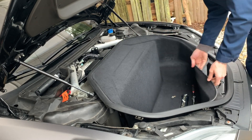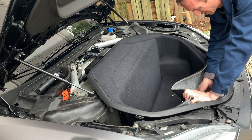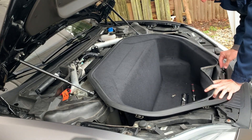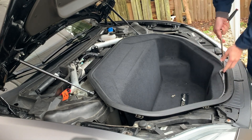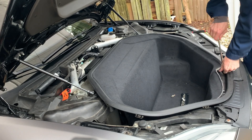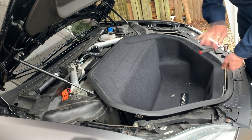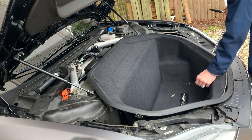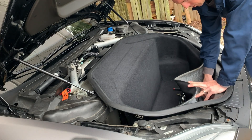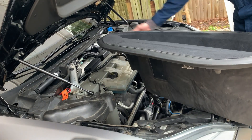I've sped things up here a little bit to make it faster — I don't actually work this fast. Right now I'm removing the frunk light. It's a simple little clip. It does take a little finesse; don't yank on it otherwise you're going to break the tabs. Just put your thumbnail in there and it'll pull right out. Right below the light is the emergency frunk release. I'm removing those two 8 millimeter bolts, and then I realized there's a rubber grommet that holds the wiring for the lights in place. I quickly removed those and the frunk pulls right out.